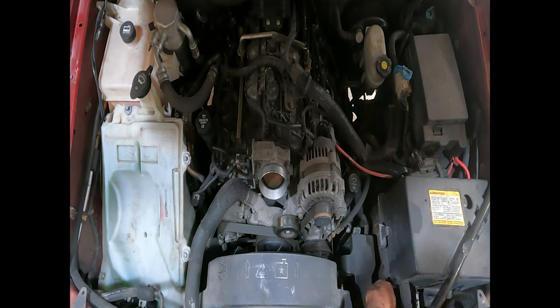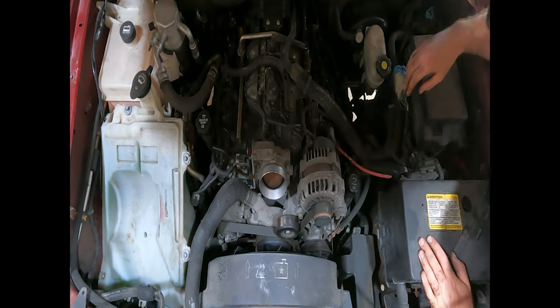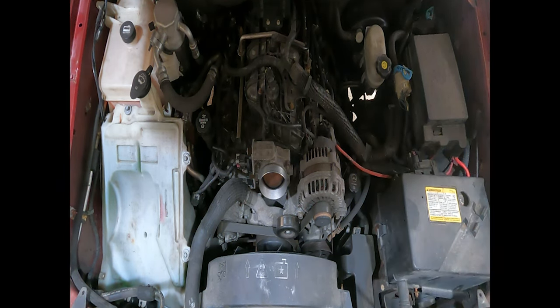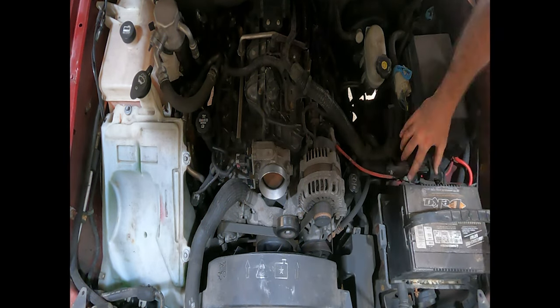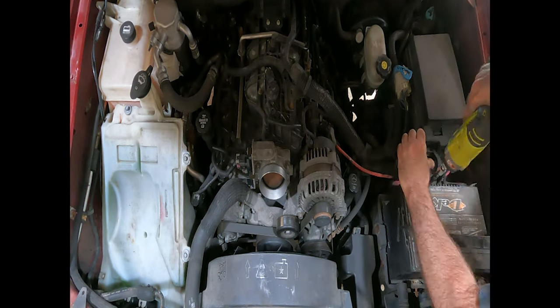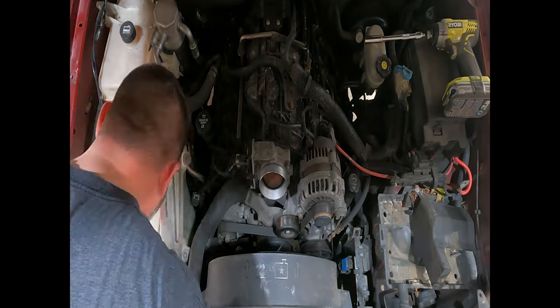to swap everything over. We installed a Texas Speed 224R camshaft, very mild, stock stall converter, stock transmission, stock fuel pump, fuel injectors, just basically a 30-35 horsepower camshaft just to give it a little bit of an aggressive tone and make it a little bit quicker and fix the issue that it had.